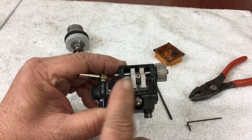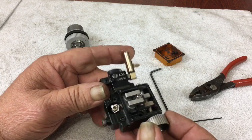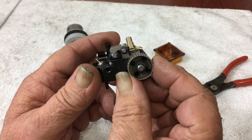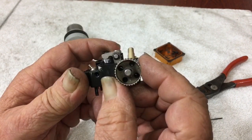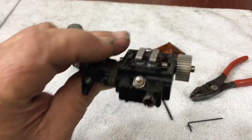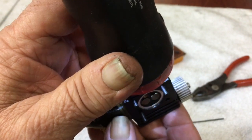So I was looking at mine. I told you guys before the rocker arms come loose on this thing, and you got to tighten them down or put a little Loctite in there. But I'm sitting there staring at this and I went to check — how much room do you have in your cam followers? Does your cam move at all? My sprocket moves a little bit but the cam doesn't move at all. And this is top dead center — this is when it explodes. Those valves should be shut at top dead center.